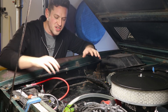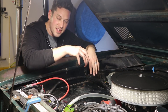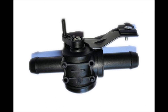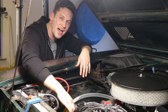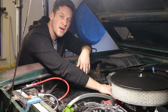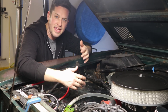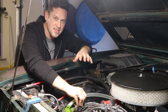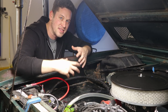I converted mine to an electric servo — you can get them at Vintage Air — but for the stock Bronco, it actually comes to this, and this is what the original one looks like. When that cable comes out of the firewall, it connects here and opens up a flap that allows that warm coolant to pass out of the engine into the heater core, warm up the heater core, and then come back to the engine. So if that flap isn't working, you aren't going to get any heat in your Bronco. That's the first place I would look — make sure that it is functional and that the cable is actually opening that flap.